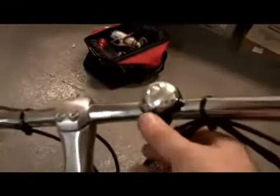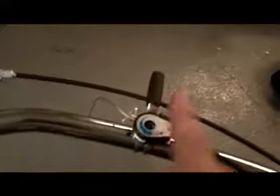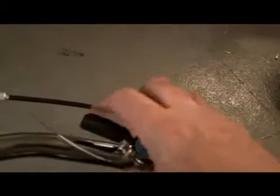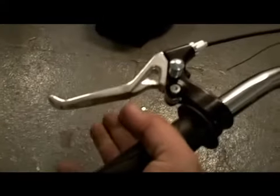For the throttle kit, I put the throttle in and ran all the cables down with tie wraps. I kept my bell — wasn't going to let that go. It comes with a choke for when you've got a cold start going on. And this is the clutch handle — when you pull it in and lock it in, the bike can pedal freely. As you're riding and pedaling, you get to a certain speed, let it out, and it engages the engine — the clutch grabs and you're ready to go.